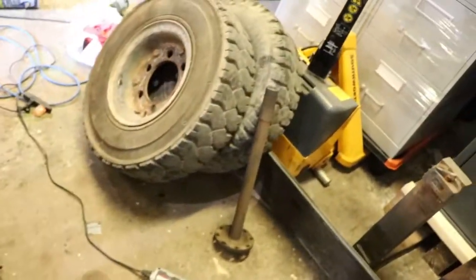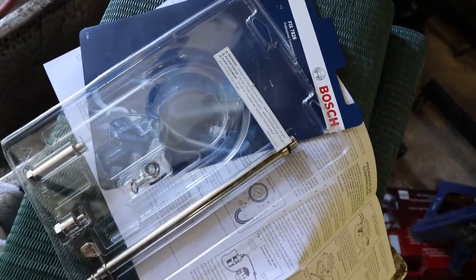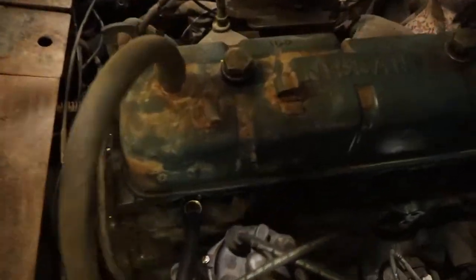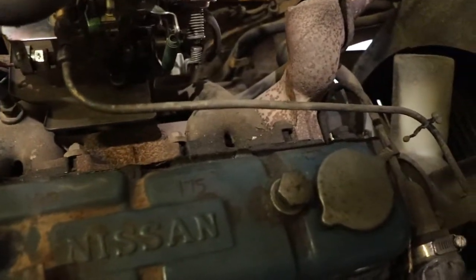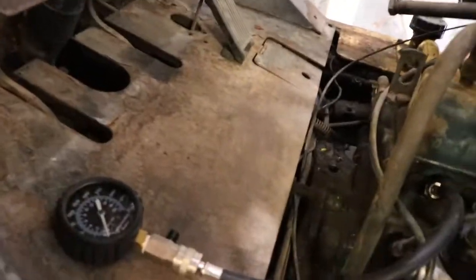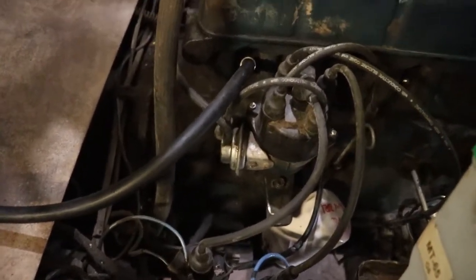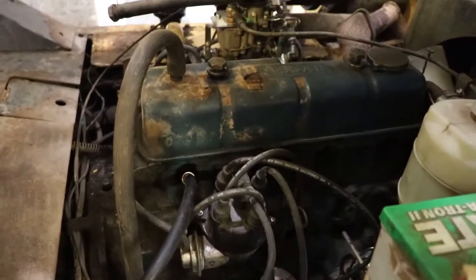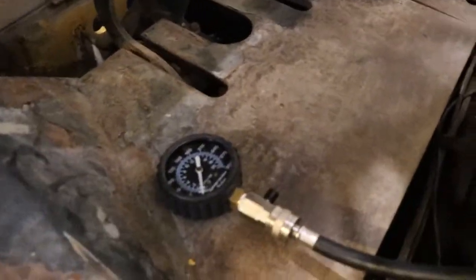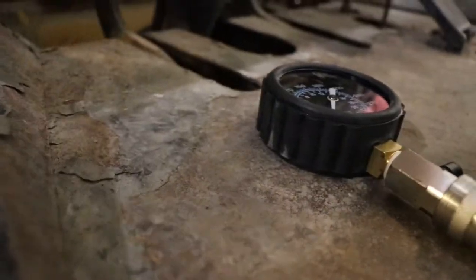I'm doing a compression test now using a Bosch 7828 compression tester — it's pretty good, it's got all the parts and isn't cheap brass. Some on eBay are in quite horrible condition. I've gone through and done the test: I got 150, 160, 175, and 155 — so 155 on each end, better in the middle. You're supposed to disconnect the ignition when you do this, but I haven't. This one doesn't have points from what I've seen — it has a Pertronix upgrade on it. You hold the pedal down and just crank the engine.